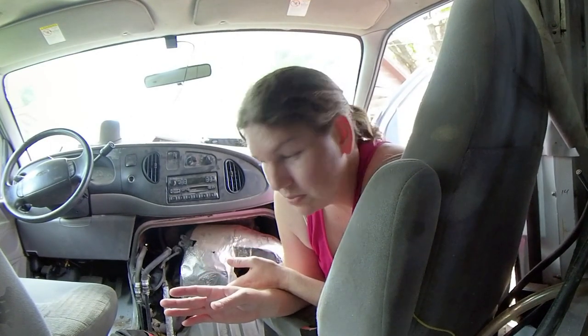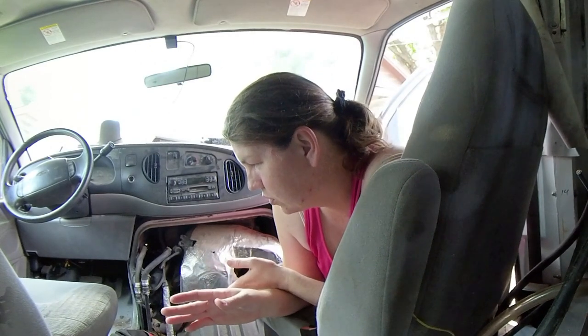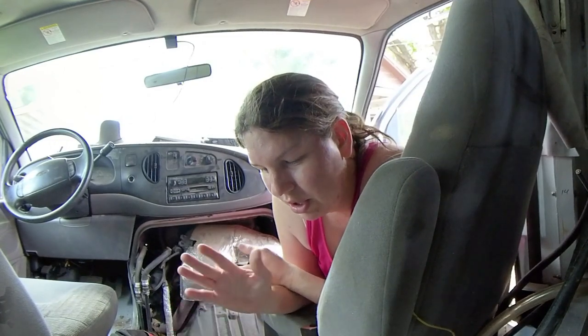I have a new floor for here, and I've had it for a while. It's just taking up space in the house. I got it relatively watertight, and I feel confident and comfortable putting the new floor in here now. So that's what we're going to do. We're going to pull out the seats and get it all cleaned up in here, prime the floor, and get the new floor vinyl in here with the new sound deadening in it. Get the seats put back in here and get that doghouse back in here, and we'll pull out a seat or something later on down the road. But at least it'll be sitting together and it'll be clean up here and drivable.